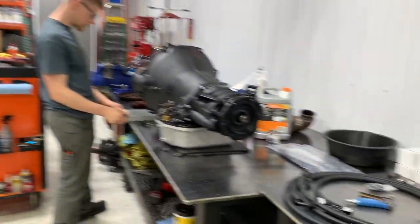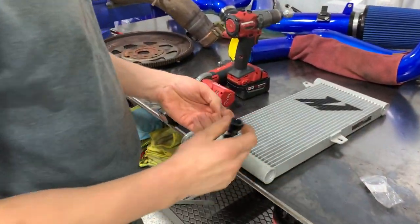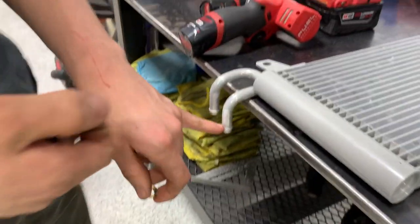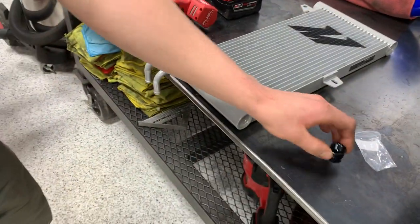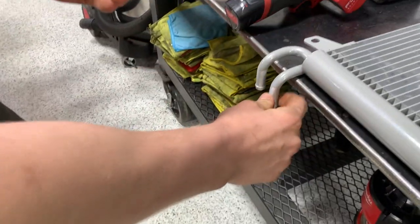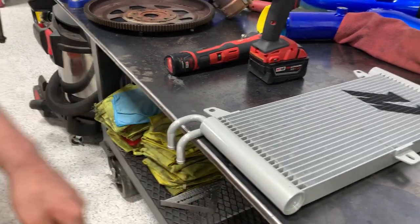Now that we have a flex plate on the front, we're coming along with a little fine-tuning. George is going to tell us what's going on with the AN fittings. These are like a hard line fitting — basically a compression fitting. We're going to have to cut this rib off so we can slide it on, and this will crush the little collar down on the line. It's a bit more reliable than a hose clamp. Let's get these cut off, deburr everything, and put them on the cooler.